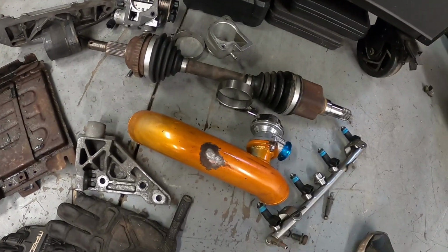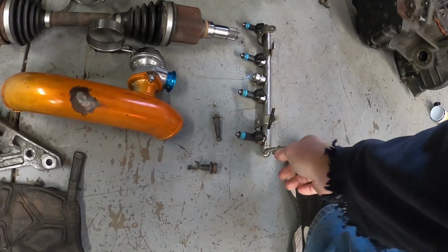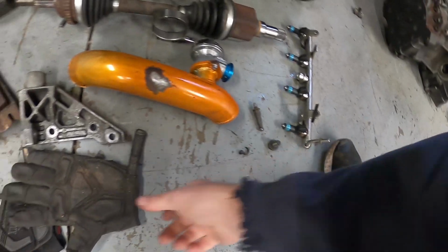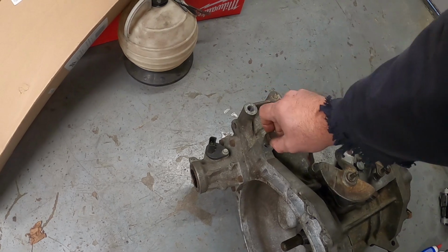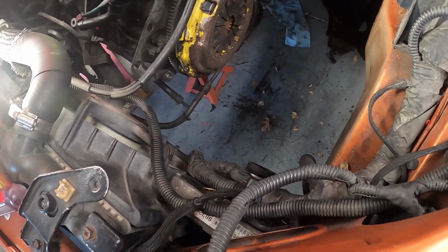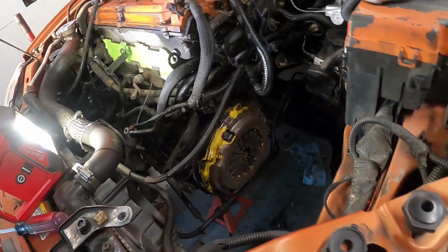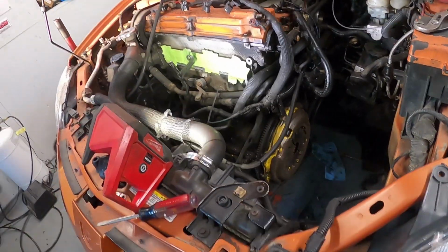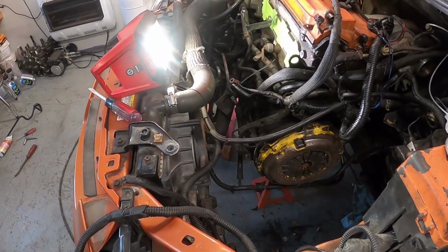We're gonna reinstall our valve the correct way. I'm gonna clean up the injectors. I gotta get those installed and replace that clip. And right now we're down to the point of getting this set down in here. Let me get the chain hooked up. I'm just gonna do the normal. I'm gonna sweep out my mess, what's down there, that way I don't have to lay in it, but we'll get that cleaned up. And we'll be ready to lift this transmission up into place and get it aligned, double check the clutch. Everything looks all right there.